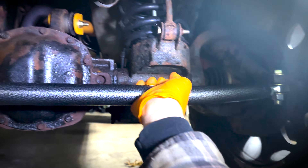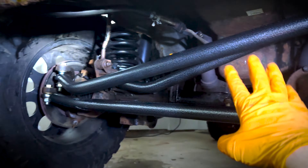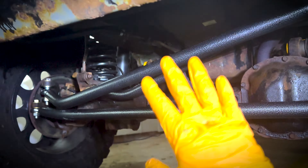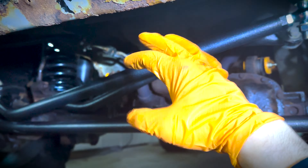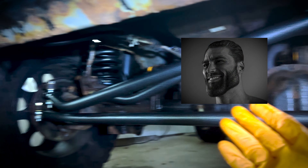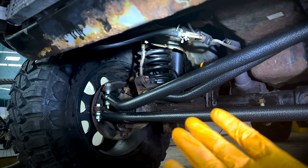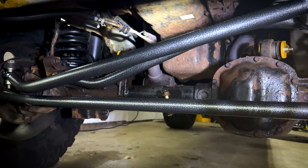If you see play inside these, this is completely normal — that's the normal amount of play you can expect to see from these heim joints. Same thing for this one. Even as you drive and if you hear kind of like a bump, that could just be your heim joint flexing. But yeah, this is kind of the giga chad of heavy-duty steering as you can get for a stock setup. Pretty happy with the overall install.